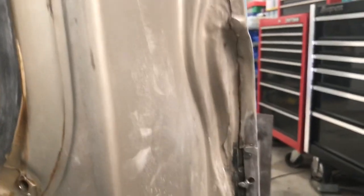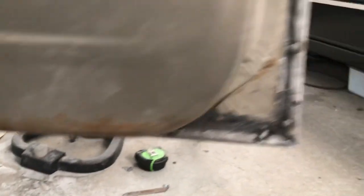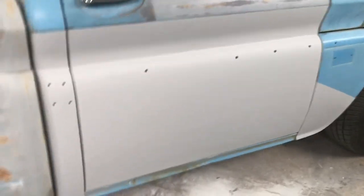Coming around to the inside here — this is where the patch panel is. Got it tacked back in. It goes down across the bottom and it's in pretty good. Looking from the side down the door, it's hard to tell but it's pretty straight. Body lines are adequate. Got a little jog right here, but body lines are pretty accurate. I'm just going to go ahead and show my flaws — you may notice I'm missing a couple of the trim holes, and that might be a spot where the body filler is a little bit thicker than I wanted. But whatever — what I was going for with this was to learn and to make it look better than it did.